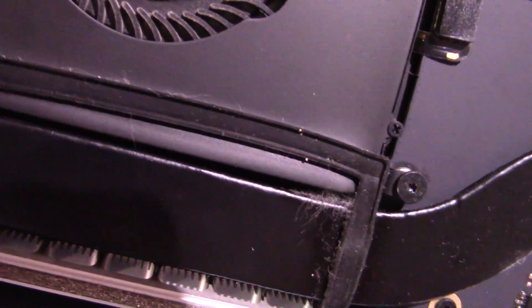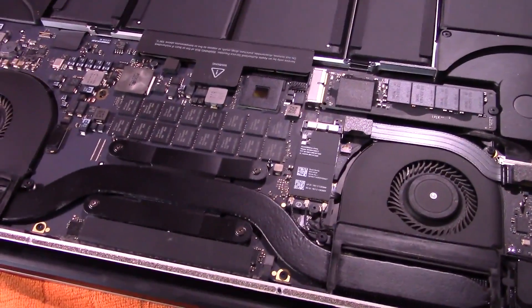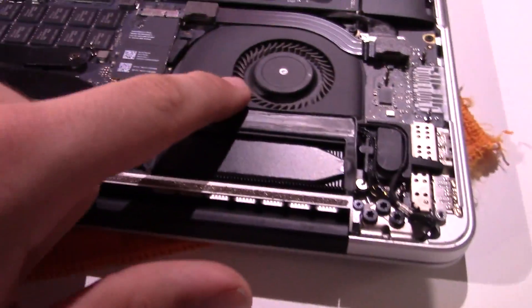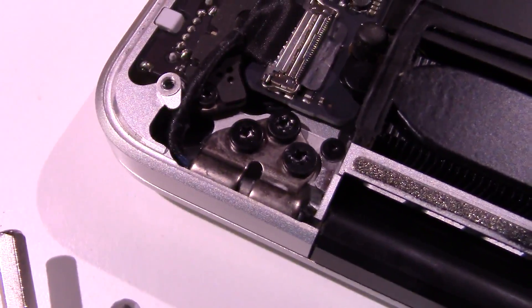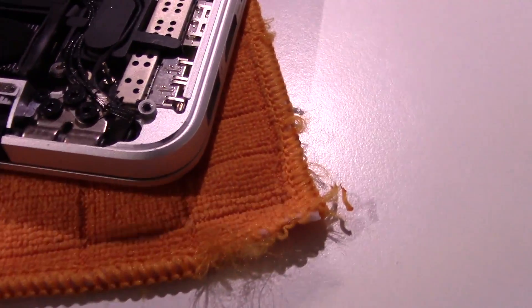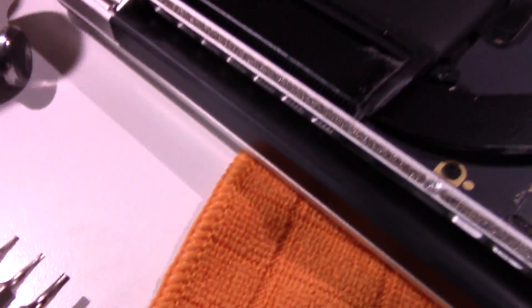I just want to make sure that these screws are nice and tight. These are Torx screws, so they're not proprietary, which is nice. I have to find the right size Torx. And here you can kind of see that some dust has been building up in these heat sinks — I will clean that out before I put the lid back on. As I've mentioned in previous videos, this is a very nice machine. You can see we have our PCIe SSD here, the RAM, the Core i7 processor, two fans — one big and one slightly smaller. I figured out these screws are a T9 Torx bit for the hinges. I made sure all of these screws are nice and tight, as tight as I can get them without stripping. I found they weren't quite as tight as I would have expected for display hinge screws, so it's probably a good idea that I did this. I'm going to place these covers back on for the hinge screws.